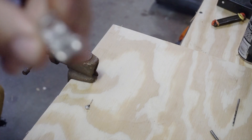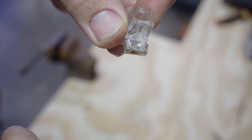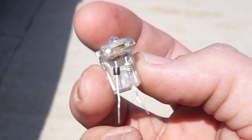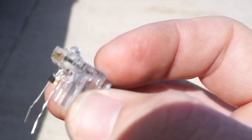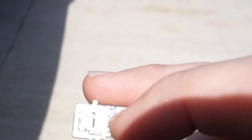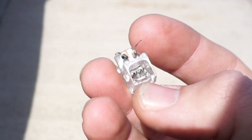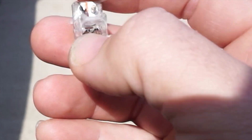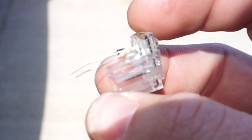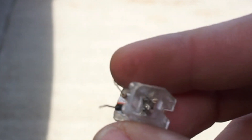What I did was push the bit over a little bit, kind of use it as a dremel, and took some of the edge out so the edge of the LED gets in there a little bit better. We're done there - all we've got to do is glue it together and we'll be ready to install. That's what it's going to look like when you're done. It literally takes longer for the glue to dry than it does to do any other part of this mod. Make sure to line it up with that lens the best you can. You don't have to do anything as far as a connector on these wires because they're about the same size - once you double them over they're roughly the same size, if not a tighter fit than the original prongs. Just like any other LED, the polarity is only one way. If you install it backwards the worst thing that's going to happen is it's just not going to work, so you need to flip your two points around - your positive and negative. Once you get them flipped around it'll start working.